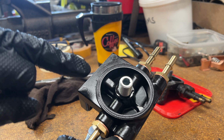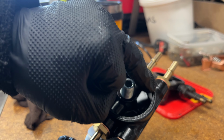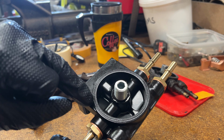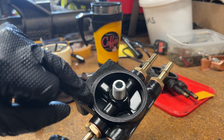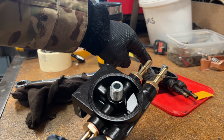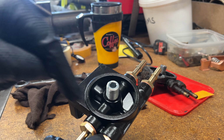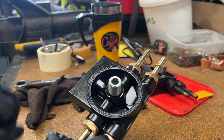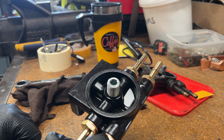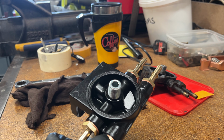I really am going to fit it now, but I just wanted to point out the surface where the old fuel filter used to rest, the rubber used to rest on this area. You can see where it's shiny. Well, this isn't. There's two raised grooves, which presumably will sit quite well with the rubber. Now, whether they used to come like this originally machined down, or whether somebody else has done the same thing as me and machined it down bit by bit over time, I couldn't tell you. But this one doesn't have a machined surface, so in some respects the aluminium is protected from the elements because it's painted, which will probably peel off within 6 months. But nevertheless, we're definitely going to fit this now.